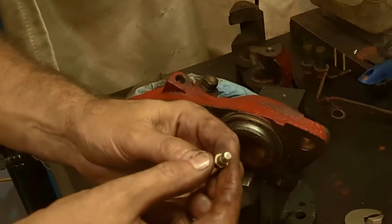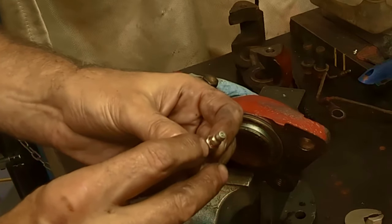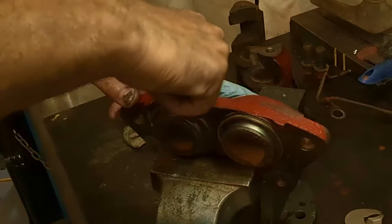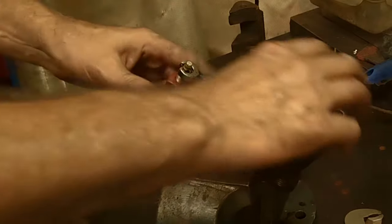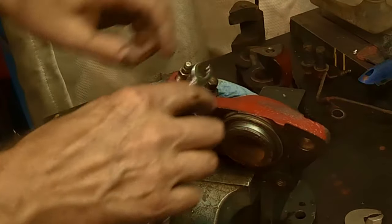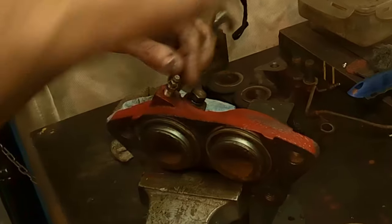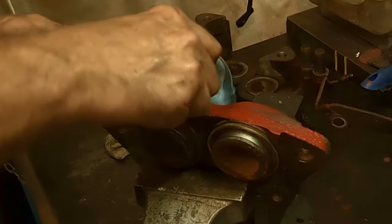So what you do, you take a tube thread nut, or a brake line nut, and tap it out and put a grease fitting in it. So this is, I think, a 1/4-inch tap. I tap down inside, I put a grease fitting in, and I put that right in the fitting hole. It doesn't have to go in tight, like it doesn't have to be cinched straight down. It just has to be in enough that it doesn't come out easily. This is actually the brake line hole, sorry, it's not the bleeder hole. The bleeder hole on these cars is over here, and you'll leave that in for now. So you put it in where that brake line came out, that we took out, and again, you don't want to crank those right down, just snug, not tight.